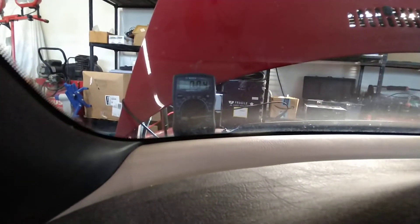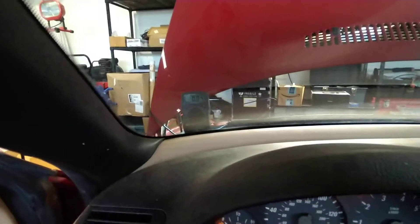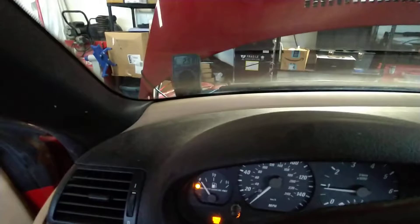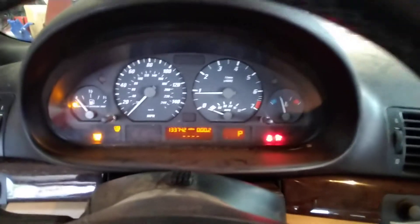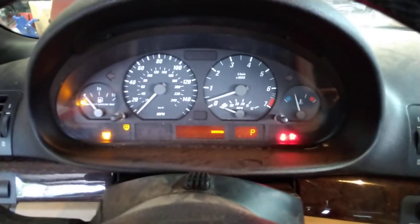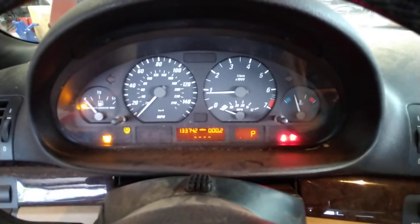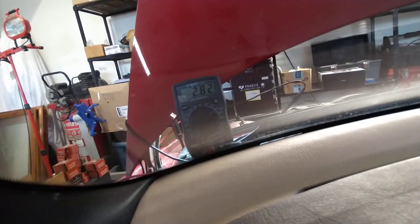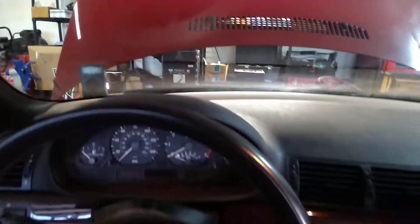Interesting enough, where's my five volts? It's not showing five volts yet — maybe it's not waking up. So I'll start cranking. Obviously it's getting voltage. Let me do it again. There it is, and then it just evens out. What I'm getting as far as voltage is two and a half on average, which is what I'd probably expect to see coming off of that signal line for the cam sensor, even though I don't have an oscilloscope yet.